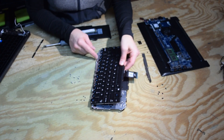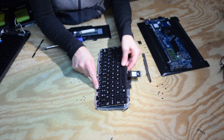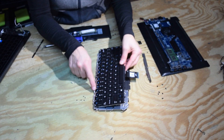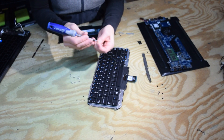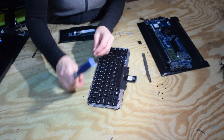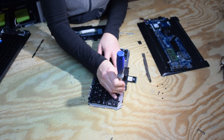That's it — you got it. Now we're going to put it back together. We reverse the process: put the keyboard back onto the back plate. It locates on the bottom with a couple of tabs and then snaps down. You're going to replace the screws that were used earlier — there are five of them altogether.